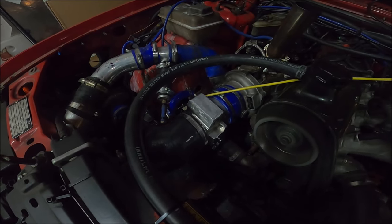Not a fucking sausage. Absolutely nothing. Well, there you go. There's your answer. Doesn't happen. Isn't needed. Myth busted. Absolutely dry as a fucking bone. And this is going from 2.1 bar on boost to suddenly a closed throttle in front of the turbo, so as much vacuum as you can get. But with a second throttle, it seems not a problem. That is fucking good times.